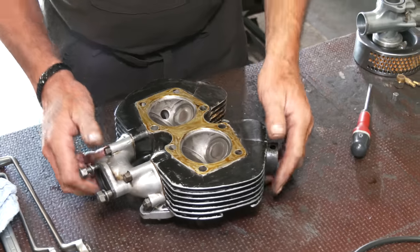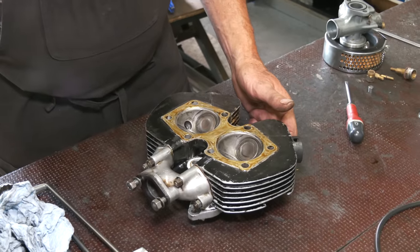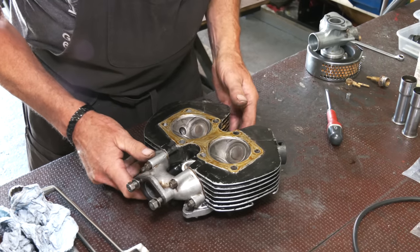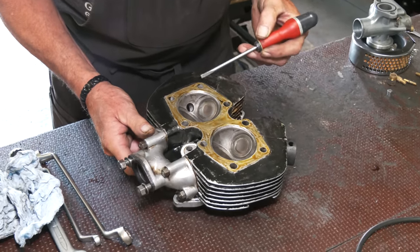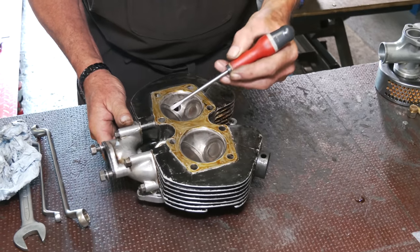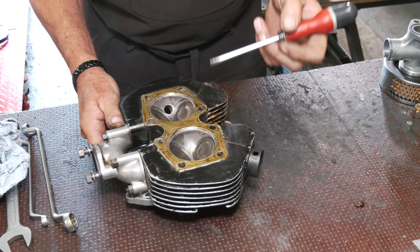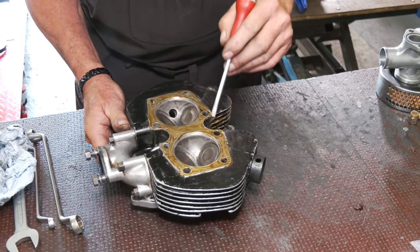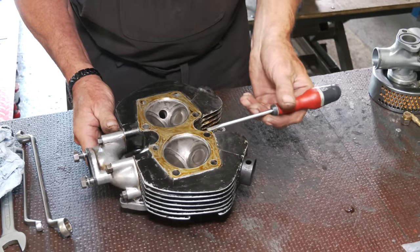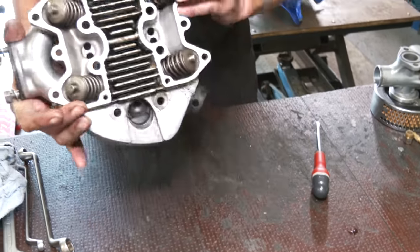Because this head, I did put it on the block over here. I've got my surface block. I rubbed the head down because it's got a lot of gouge marks. Now here, I've tried to get as much out as possible, but I've slightly coated this with Wellseal as well. Normally you shouldn't need to do that. It's got a copper head gasket, but it will just make sure it doesn't leak because it's got some nasty ones here and a big one there. So there's a bit of Wellseal all over that. So that's all cleaned up.